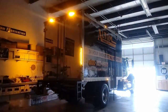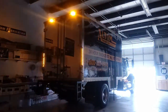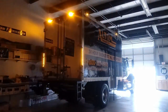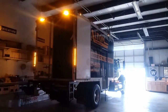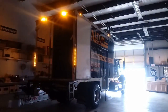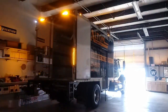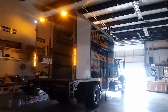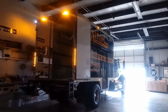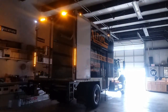We're doing a triple flash each way. We didn't want to do anything overly obnoxious because the men that work in this truck will be around the back more than the front, and I don't want to be blinding the guys trying to do their job. We were very careful to place the lights in an area where when the doors are pinned open, none of the light is blocked. That's why we did them right there on the corners — doors open or doors closed, you get all of the needed light. There are also LED work lights up on the corners outside. The one on the right is waiting on a pigtail plug — the light's fine, I was just shorted a pigtail — but it will be working just like the passenger side very shortly.